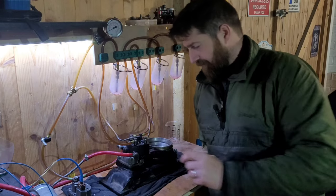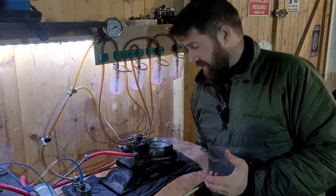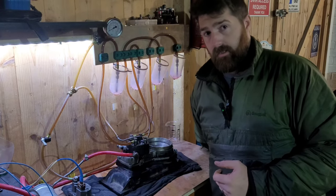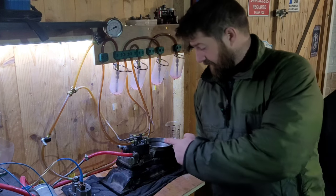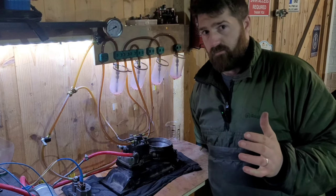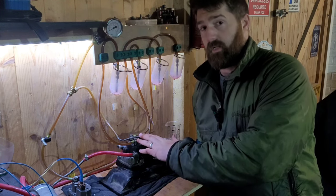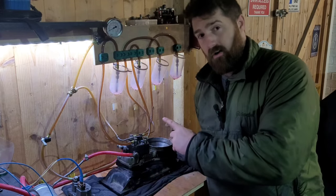This air meter is fault-free and non-adjustable, so literally whatever the engine can suck and lift that plate is what fuel comes out. I tested it at five bar system pressure maximum and we're getting out 200 millilitres a minute of fuel straight off the cuff. That's more than my Mark 2 is doing, but that's not saying this is chucking out 200 millilitres a minute into the engine, because it requires the engine to lift that flap high enough to actually put that fuel in.